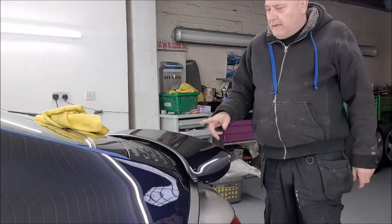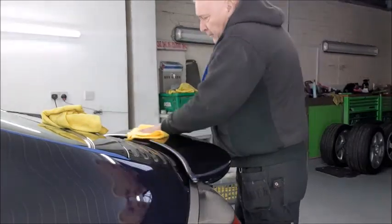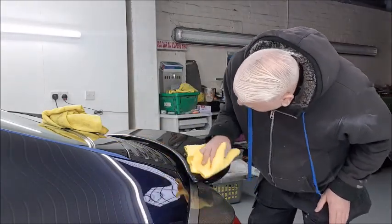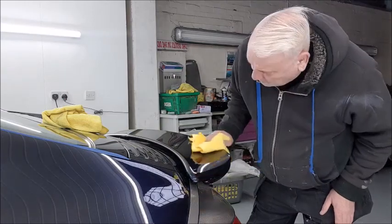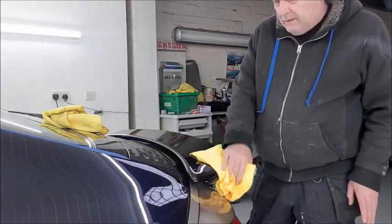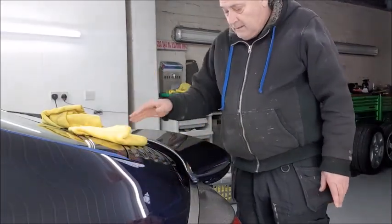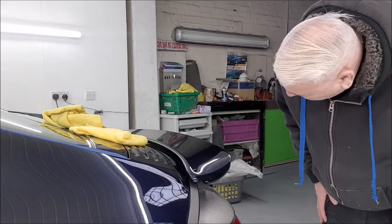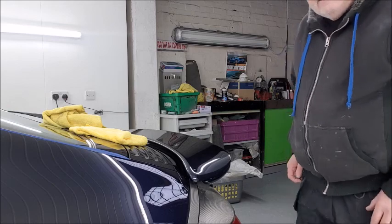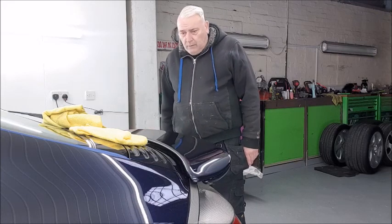This is just some of the third stage of polishing to get the flatting marks out. But we started to get the gloss coming through and the final flatting marks have been removed. And then once this stage is finished, it will have one more, really just to enhance more gloss, but it is coming up quite nice. Still a bit more orange peely than I'd have hoped for, but it still looks 100 times better than how it did before. I mean, it was terrible.